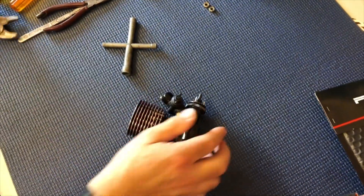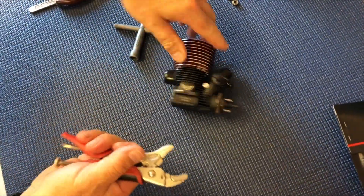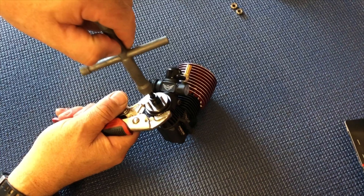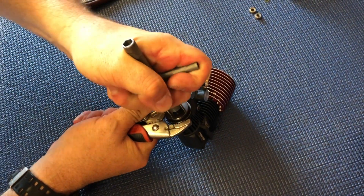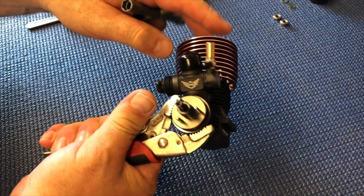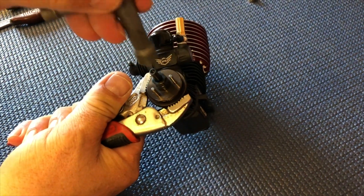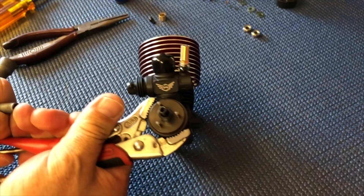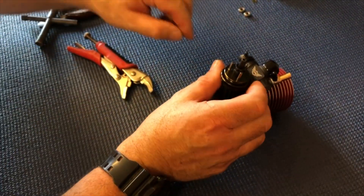Use your clutch nut spanner — just nip it up, then check you've got no back plate movement. That's perfect, there's no play at all. Move your mole grips and just gently grip it — just a little bit tighter. It marks it a little bit, but if you keep doing this in the same place as the marks you won't badly score up your flywheel. When you do the clutch nut up, line the point of the nut with the pin and you won't have any problems putting your clutch springs on. Just a little more of a tweak — you want it dead in line.